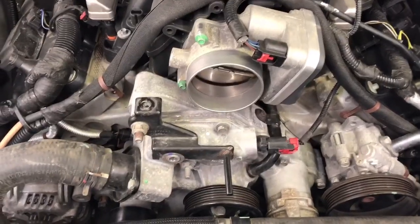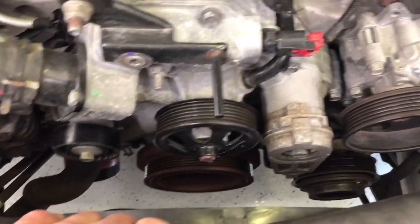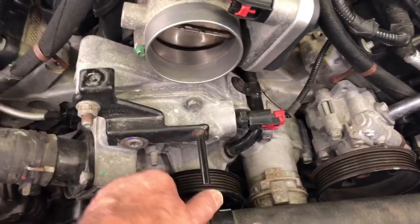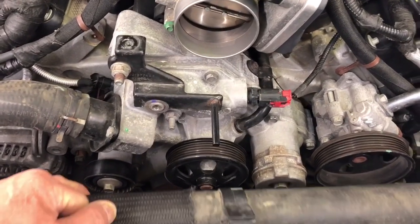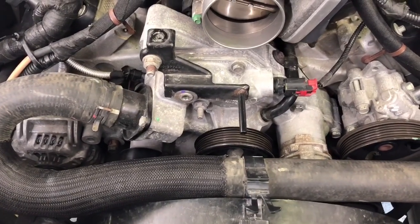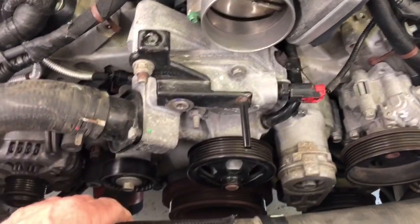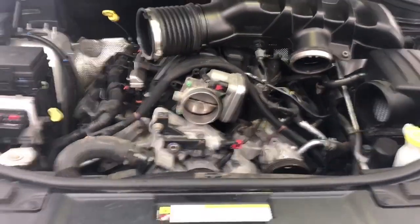There's the water pump right there — it doesn't seem too awful bad to get to. I pulled the serpentine belt off of it, restarted the engine just to verify that's where the noise was coming from, and the noise disappeared. The water pump doesn't feel bad, but it's definitely making noise when the engine runs. I've got a trip coming up soon — Boss Halls Rally — I'm going to tow my motorcycle down and meet a bunch of people. I can't risk taking this out there with a bad water pump on a four or five hour journey.